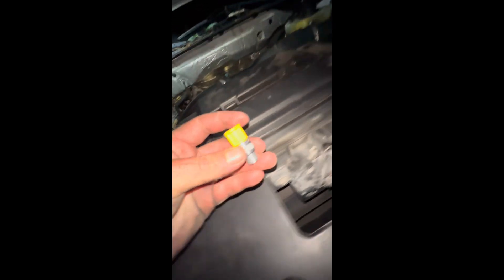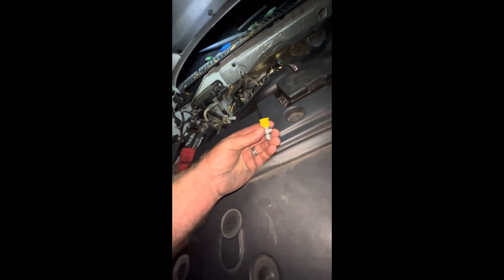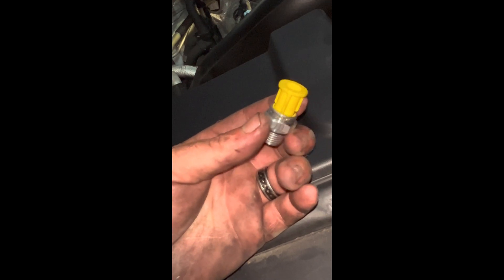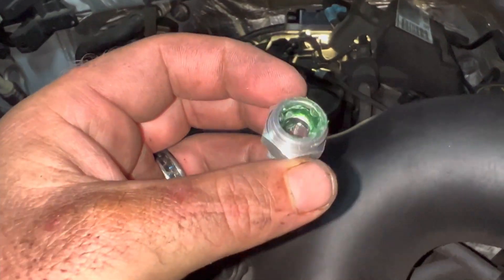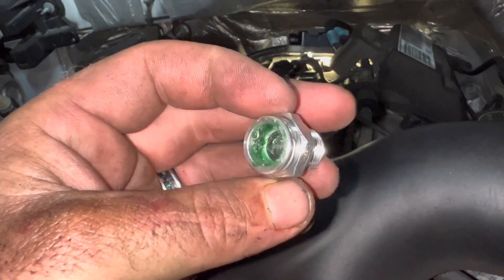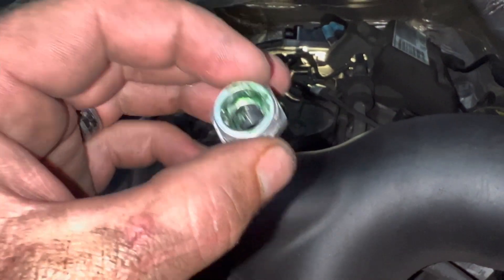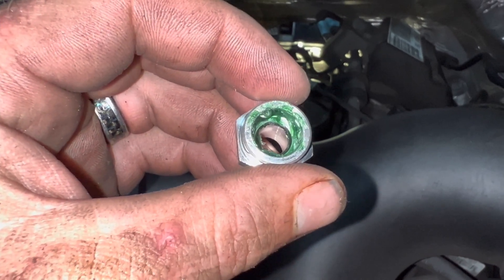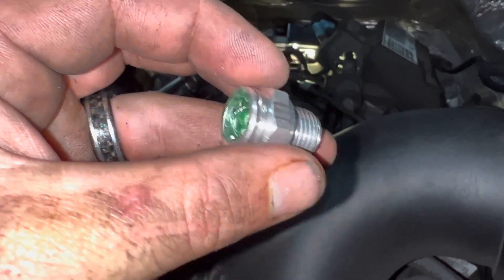Here's the new one, and you have to — basically have to pop that clip out and pull the yellow thing out. Not really sure why the yellow thing's in there. Okay, so I got that fitting pulled out, threw some assembly grease in there. We'll thread this back in and then snap that fitting in. You can leave the clip in there because the way the hose snaps into it, it pushes the clip outward just enough to go past it and not push the clip out.